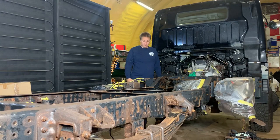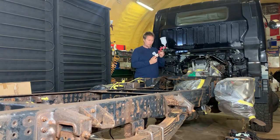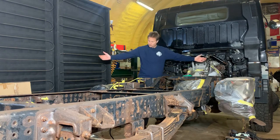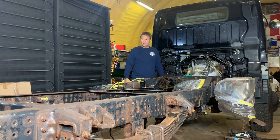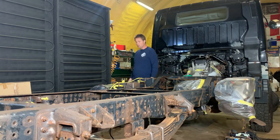Well, I believe I've got everything ready to go — pretty much everything taped up. I've got a new desiccant dryer on my paint gun, got my gloves ready, my filters ready, long sleeves, and I think the only thing left to do is fire up the compressor. I've drained the tank of all the moisture. Fire up the compressor, hook it up to the desiccant dryer, mix up some paint, and put it on.